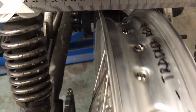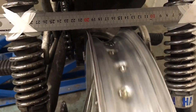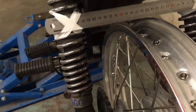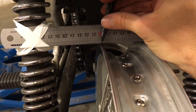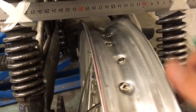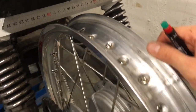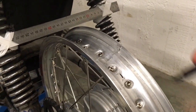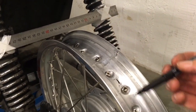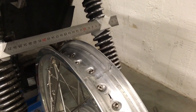That's the direction we want to go in. I've done the same thing for radial movement — there's one here. Instead of feeding the pen in from the side, I've fed it in from above and marked out the high point here, and I'm going to slowly work that rim down towards the hub. It's a step by step process and that high spot is going to keep moving, but we're going to get closer and closer to a perfectly centred rim and hub.